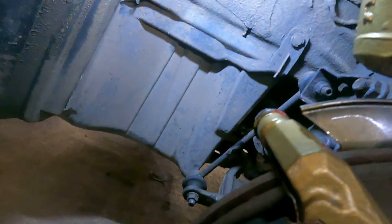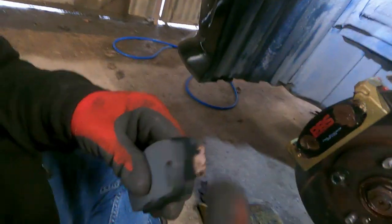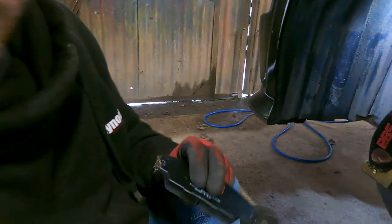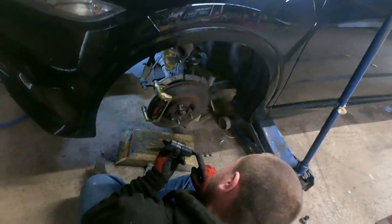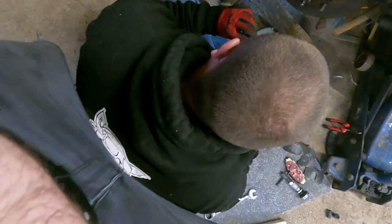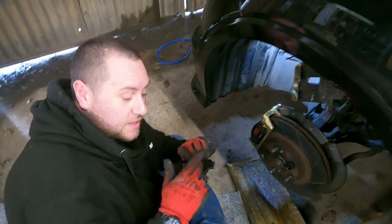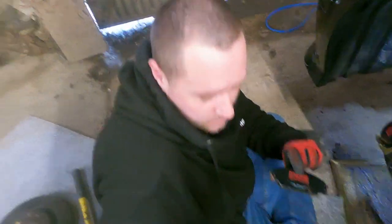You've got a bit of grease in the little slidey area. Yeah, he's done that. Oh, yeah, look. Put them on there. A little greasing bit of... Greasing the tip. Oh, I love greasing. You've got to do it, guys. For the price of a bit of copper slip, it's worth it. It is. And then on your back one... On your rear pad, always make sure you put plenty where your piston is going on there.